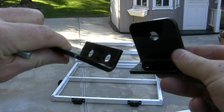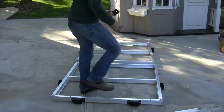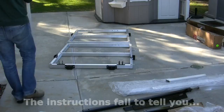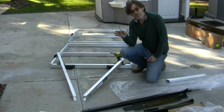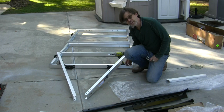So there are eight stake holders in total — four on the front half, four on the back half. These next pieces are shaped like an L and go in this orientation, right where you're about to see me put them. With attaching these, they say to bolt them on using the same M10x25 bolts. They don't say whether you tighten them all the way, but I'm aware this is supposed to swivel when you fold it up. So I'm not sure how tight these should be — I'm going to snug them. They are lock nuts, so it's not like they're going to loosen up. It's a guess. Maybe we'll find out in the end.